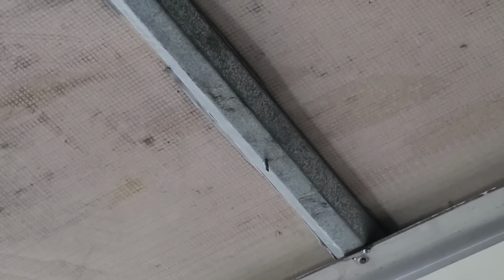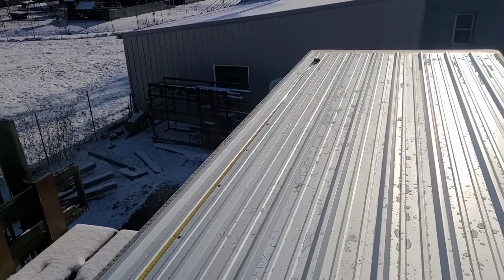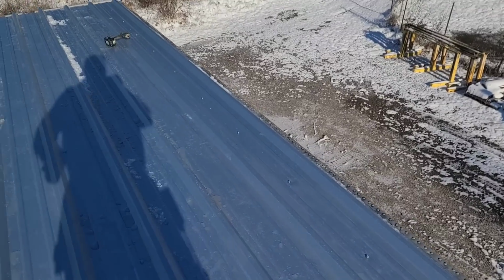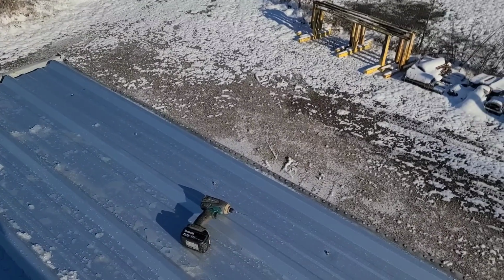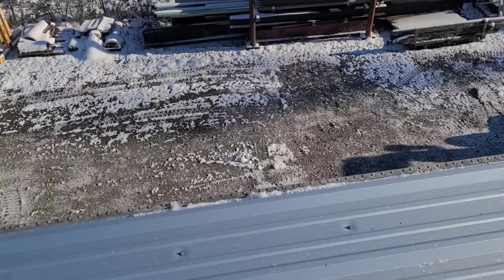See that or not, but that screw is as far to the left as it can be and still land in that middle section of that brace. So obviously we need to go a little less than 2 feet. I put in that row towards the back, flipped this around and went that way, and what I found is as you go, you got to go a little bit less than 2 feet. I'm going by feel, but based on the shape of that piece underneath of there, you reach a point where it feels like the tip of your bit kind of hit that slanted corner, and you can still drive that screw, but you can feel which way it leaned, and by that, you know if you need to go less than 2 feet or more. Well, I've found that you have to go less.